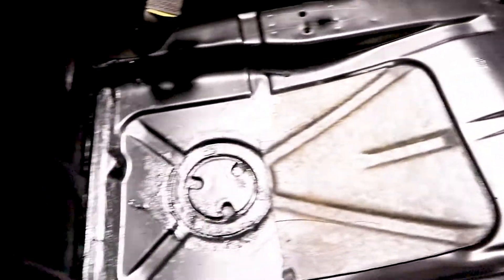Here is the interior of the vehicle. As you can tell, we have refinished the floor pans — they look fantastic. We did have some rust buildup, just a little surface rust, nothing structural, but we went ahead and took care of that. We will have to kind of work around these wiring harnesses in the floor. We did take the air vents that go to the back of the car off as well, just to get a good flat plane to put these insulation panels in.